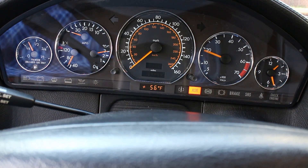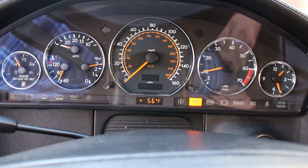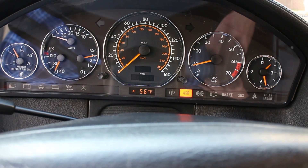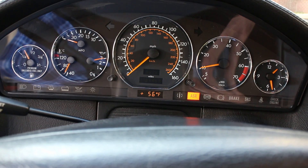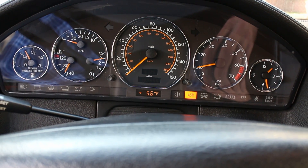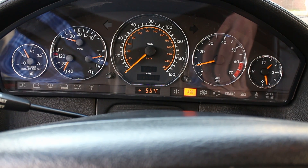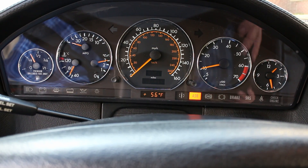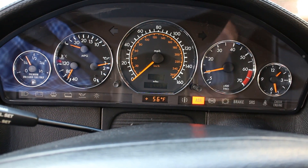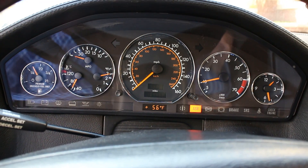We're still in limp mode, but see the difference — now because the primary is working, I can accelerate but only on six cylinders. Basically all 12 run on idle, but six cylinders are getting more air than the other six. There is still some acceleration happening because the primary one is connected. Looking at the gas pedal, there is acceleration.